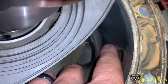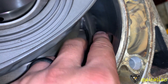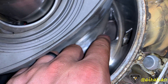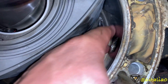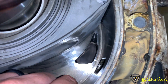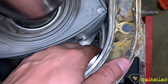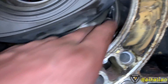Comparing these two ports — this being the smallest production peripheral exhaust 13B port — it opens sooner than the MSP port, but the MSP port closes a lot later up here. I don't think there's enough material to actually remove to match that. You can look right here in this exhaust sleeve — there's just no way you can port up that much, even with RX-5 exhaust sleeves and stuff like that. There's not enough material.